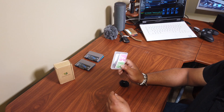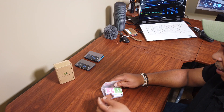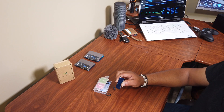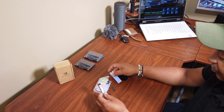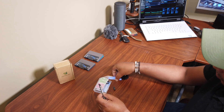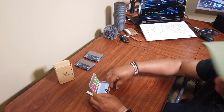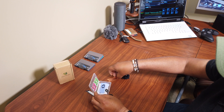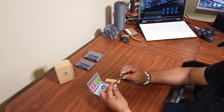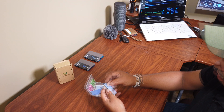The next thing was the heat shield. I've set this heat shield up so you can see how it was intended to work. This is the Toshiba SSD 512GB that came with the laptop. In this particular kit, you get some alcohol wipes, thermal pads, and several little rubber bands. And here's the heat shield itself — in terms of heat shields, it's really thick. So you take your SSD and apply the thermal pad to it.